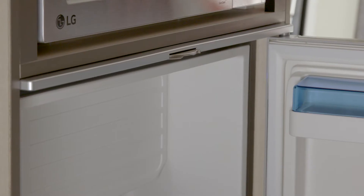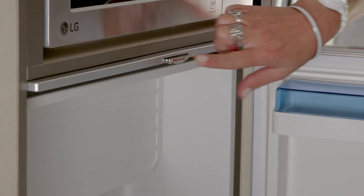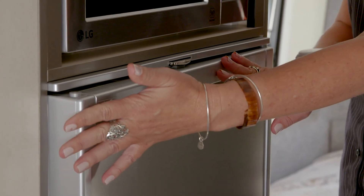When you're not using your motorhome or fridge and you need to let it vent, open your fridge, turn the disc to vent and close the fridge door. This will lock the door in a position where it is just enough to vent.